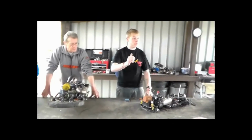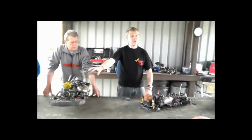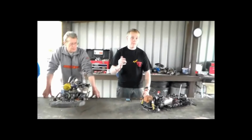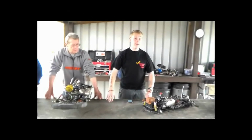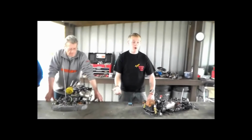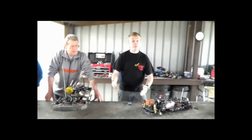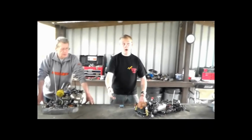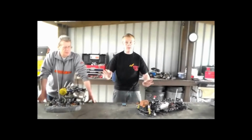You have a smoother steering style. So if they have a smoother steering style, they can afford to have a bit more aggression on the front end because they can control that front end. Whereas I'm a little bit slapstick, so to speak, in terms of I just go into the corner and I'm more like just turn in and that's it, and I expect the car to do what I want it to do. And other drivers, they're like, nope, I want to take it easy. Therefore, they can have a more aggressive front because they can control that. Whereas if my car was set up for an aggressive front end driver, I wouldn't be able to control it because I'd turn in and the car would just go into the grass and that's it, and I'd be like, no way.